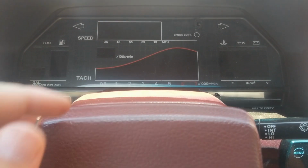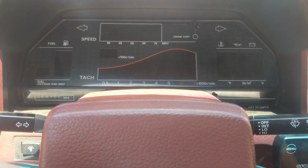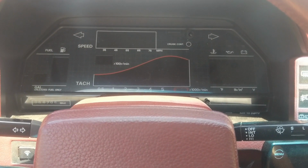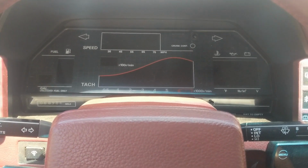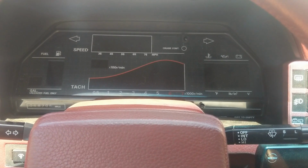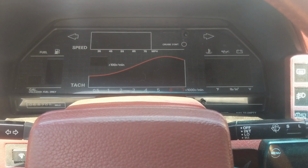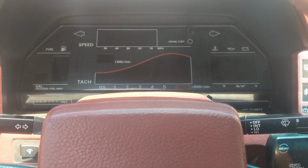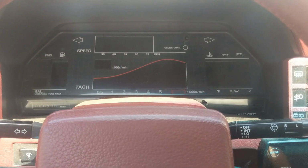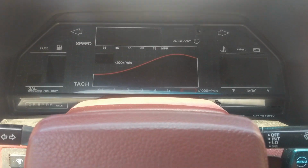That's no problem. The tach is wired to the gold box, and the gold box's tach output goes to a tach signal adapter that DIY Auto-Tune makes. You can find it on their website. So it's wired into that, and that's wired right to the tach signal for the dash, and it just works fine. You just have to scale it a little bit in the Megasquirt settings. That's not a big deal.